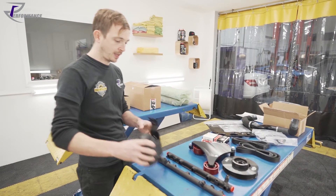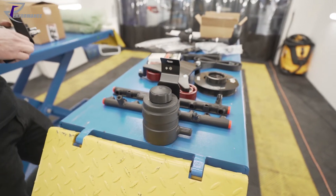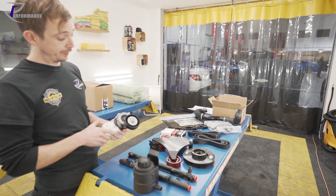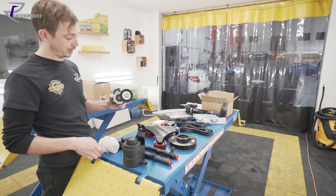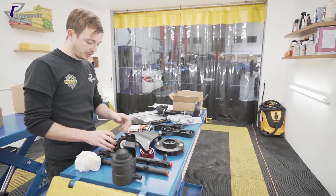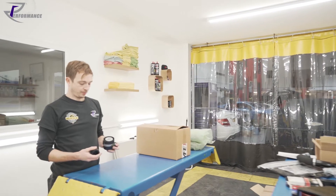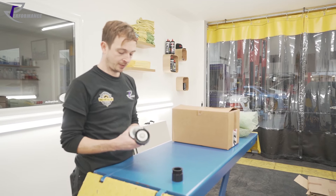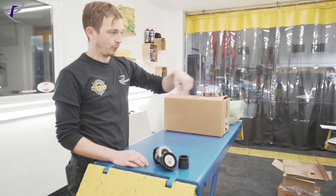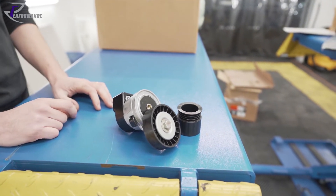Nice header tank — the water system. Because we change the assembly or the fittings on the front of the engine, we run a different alternator belt tensioner, which replaces the standard one. Modified alternator pulley and alternator tensioner as well, because we're changing the belt layout on the front of the engine. With the supercharger assembly, we have to modify how the alternator belt is driven, so we change those little pieces.